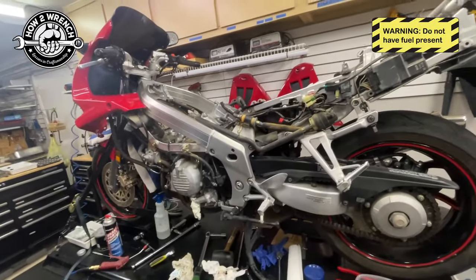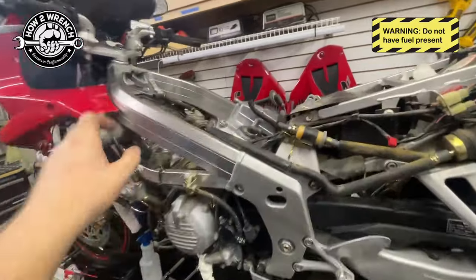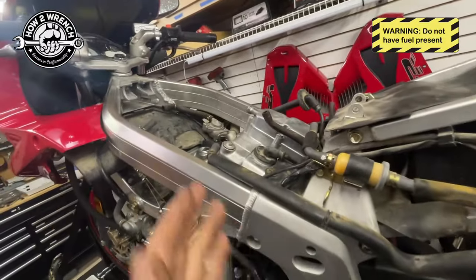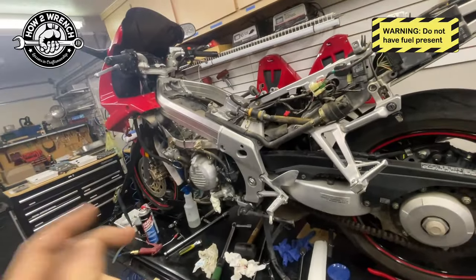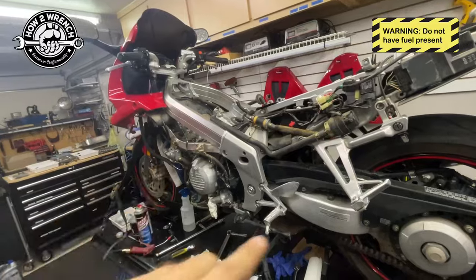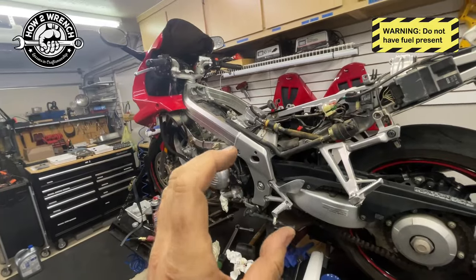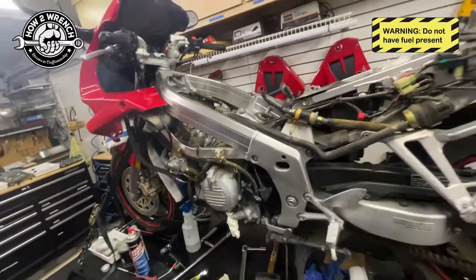The people that skipped this part of the video are missing out — but you're not, because you're here. The other thing I'm doing that is super crucial: I have all four spark plugs in. This is a dummy plug, one of the old plugs. Why is that important? I'm checking all these ignition coils' ability to fire under that compression load of the motor. If you have no plugs in, the engine spins really nice and easy, meaning the rotor spins faster, builds a bigger electrical field, and you get bigger, brighter sparks. By doing this under compression, it slows it down and loads the system the way it works in the real world.